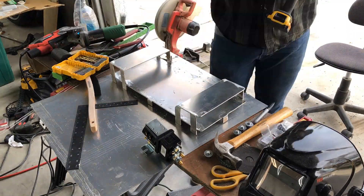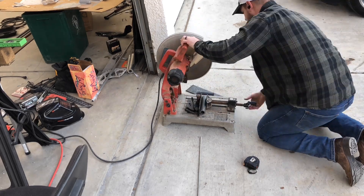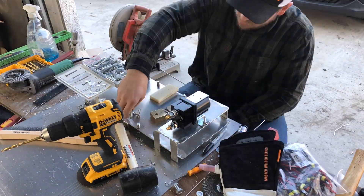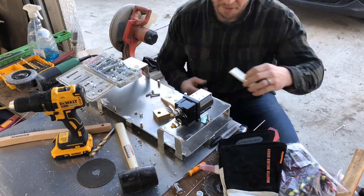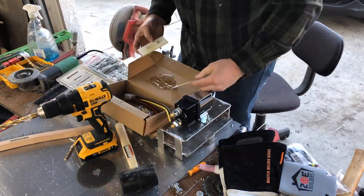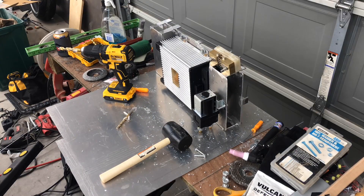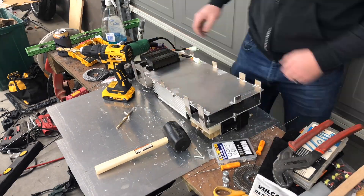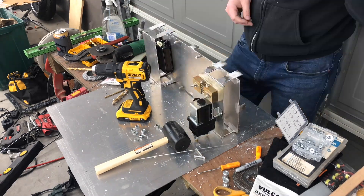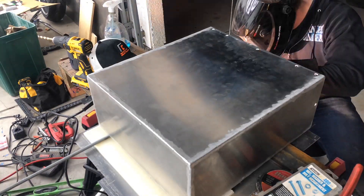One challenge with this battery case is it's so precisely the same height as the battery that anything going into or through the lid has to be flush on the back side. Here I'm using a sheet of quarter-inch thick ABS plastic to electrically isolate my shunt — shunts are usually just copper, brass, or metal screwed directly to a platform that cannot conduct electricity. I used those plastic layers to separate out studs allowing me to mount it downward and mount the shunt upward without conducting electricity through the platform. Then I mapped the placement and attached the DC-to-DC converters, drilling holes and counter-sinking with angled-head screws to keep them flush on the back side.